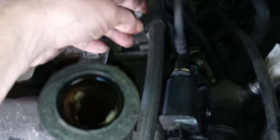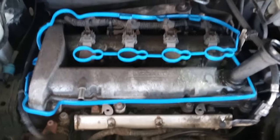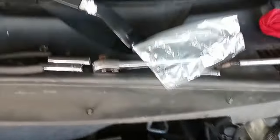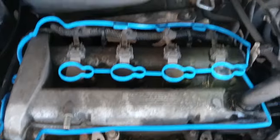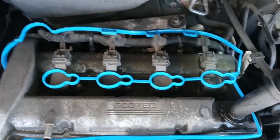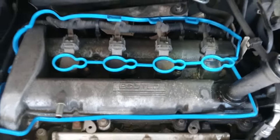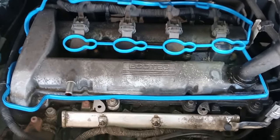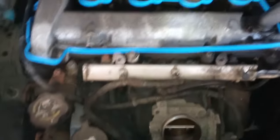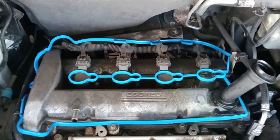It shouldn't be too horrible a job. It is only the valve cover gasket, but you do have this fuel rail right here with a screw holding it. We've got the upper air filter compartment taken off and this is what the valve cover gasket is going to look like. We've got a bag of grommets for the screws. I counted about 14 — I'm not sure I see 14 screws at this point, but that's how many you have. This is basically how the gasket is going to lay out. It also has the gaskets for the spark plugs. Four grommets for those, then ten going around the outside. Hopefully this won't be too big a job — I'm gonna wear my GoPro moving forward.